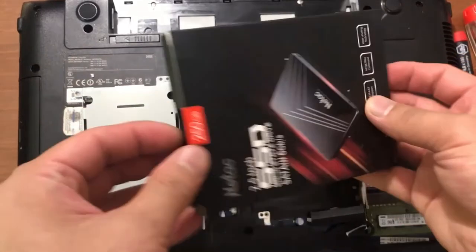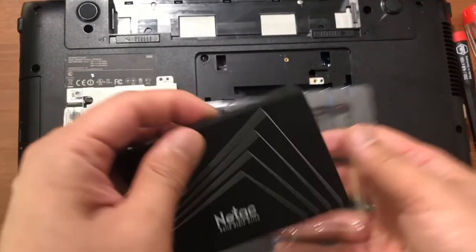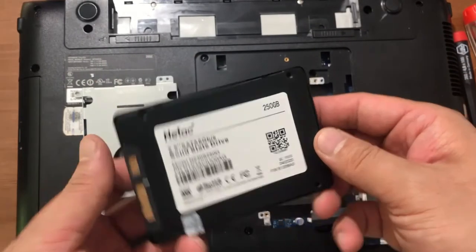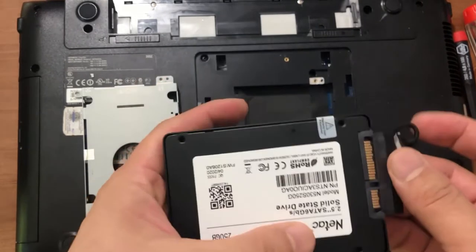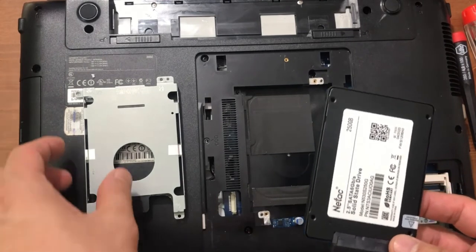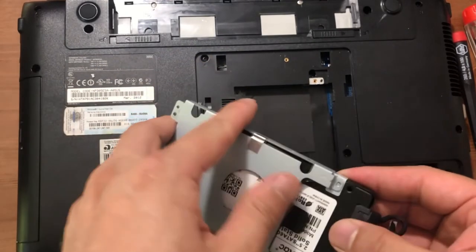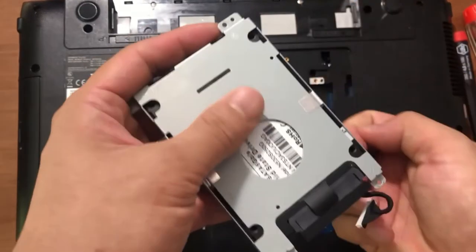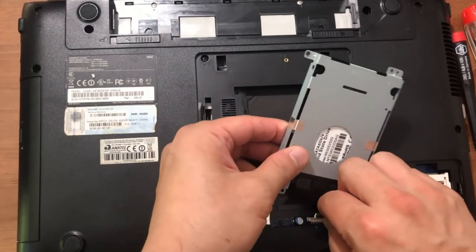This is my new SSD — opening it up and taking it out. It's a pretty straightforward installation. It has the same cable pin-outs because laptop OEMs follow standards and specs, so you don't have to worry as long as your SSD card is the right size for your laptop. I'm going to re-utilize the case, put all four screws back in with the new SSD card installed, and then plug the cable harness back into the slot.